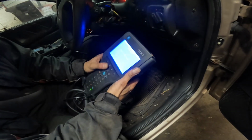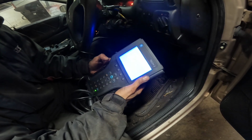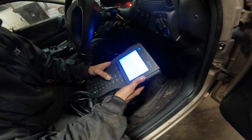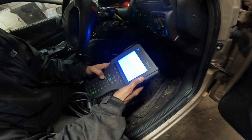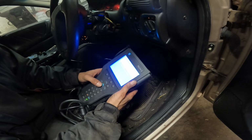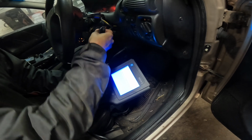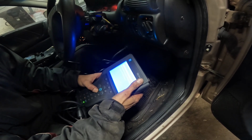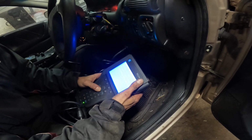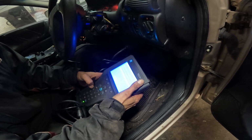Now got the Tech 2 on to check what fault code we had on it. And the advantage of the Astra being a wee bit more than the Cavalier is we can use this. How many is it going to spit out? No speed signal and immobiliser wrong signal. Okay, well it wasn't getting a speed signal because the thing wasn't working, but it was probably jumping in and out, probably getting a bad signal. An immobiliser wrong signal, that's because the key wasn't there for it. Okay, so that's nothing. And that's all that's stored. Right, we'll just delete them. Minted, didn't even have any. That was it.